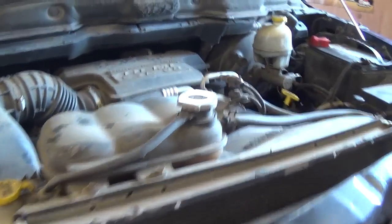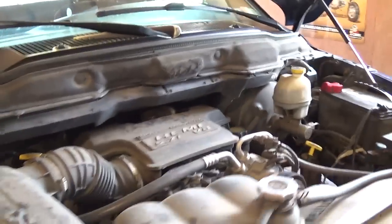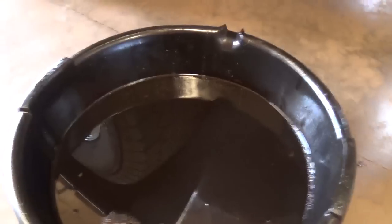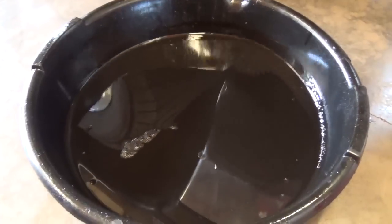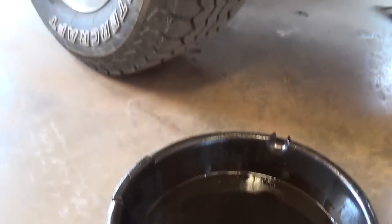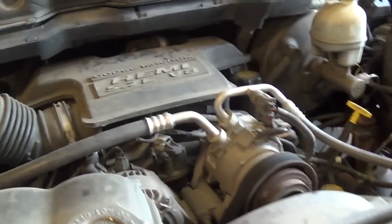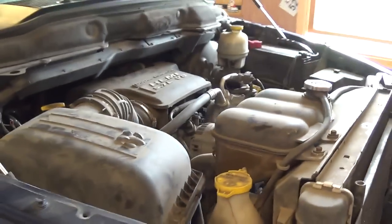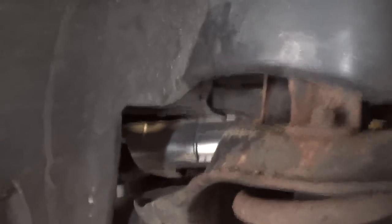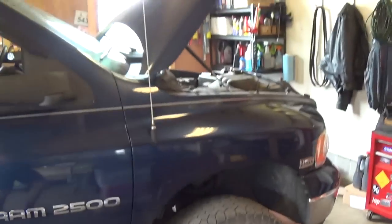Last but not least, we're doing an oil change. The capacity for this 5.7-liter HEMI V8 is seven quarts of 5W-30 oil — and this is how much we drained out: maybe three quarts, about as much as my motorcycle takes. Nothing on the dipstick, so I think the owner made a wise decision to go for the oil change instead of just topping it off. It is making some valve lifter noise that might be related. One thing I haven't done that I'll give a quote on is the manifold, which is leaking right at the rear stud. That might be the last thing to wrap this truck up. Thanks for watching, hope you enjoyed the video series — stay tuned for more.